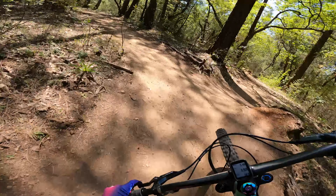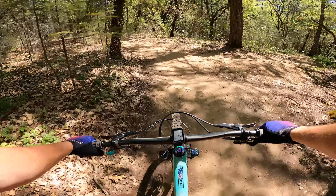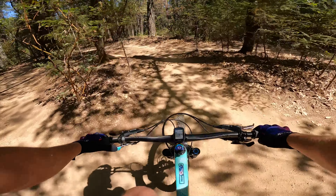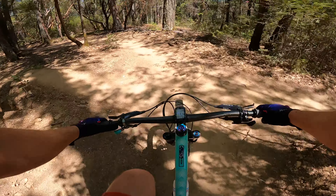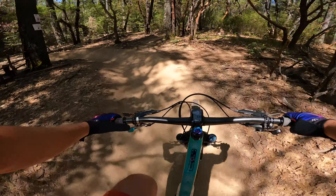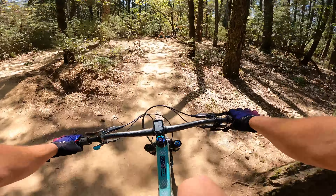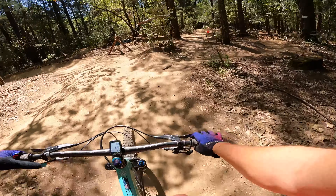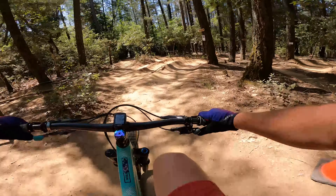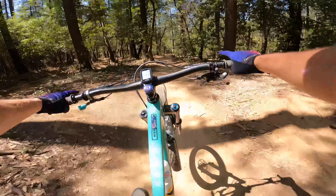At speed it feels pretty darn good, actually. I did notice it was kind of harsh yesterday on Buckeye at Skyline, so I ended up taking out just a little bit of pressure because the oil is actually doing its job now and making the fork work how it should. Seven months is a long time to be on a fork without servicing it when you're riding every day — feels a heck of a lot better.